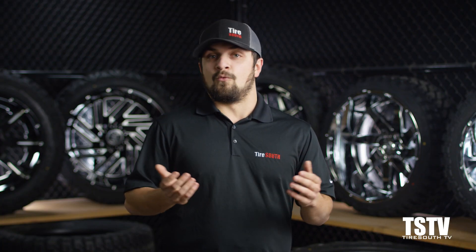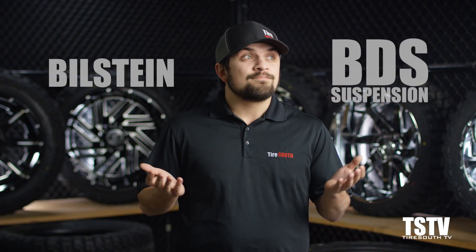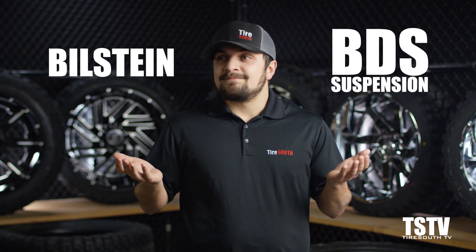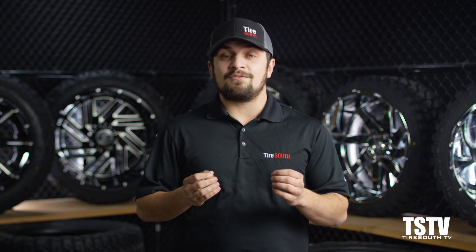Now that you know the differences between the kits, which one should you get? There are a lot of brands out there but for the most part they're all pretty comparable. With most full-size trucks and SUVs, a leveling kit will yield you at least a 33-inch tire with factory or aftermarket wheels — on some you can even go bigger. On one-ton vehicles such as F-250s or 2500s, you can get a 35-inch tire with a leveling kit, especially when retaining the factory wheels. On the new Super Duty F-250s you can actually squeeze in a 37-inch tire with a leveling kit and factory wheels.